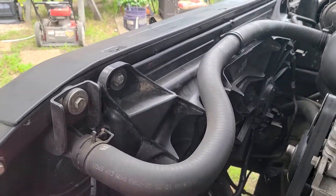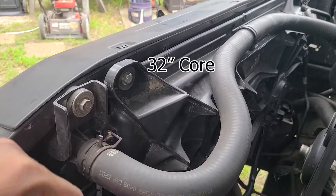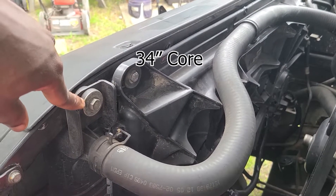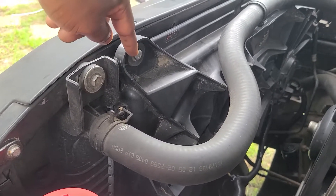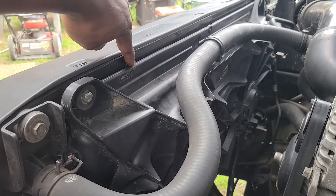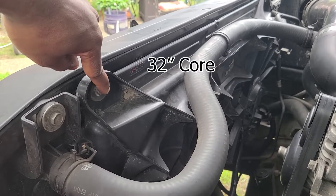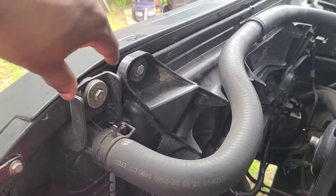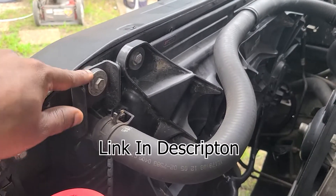Now how do you know if you got the bigger radiator? Go outside and look right now. If you got the small radiator, it's gonna be screwed right here. With my electric fans and the bigger radiator, it's screwed on the outside because the smaller one doesn't take up as much space. If you got the fan clutch shroud, it's gonna be screwed here — and there's nothing here, you got an empty screw hole. If your screw hole is out here, you already got the bigger radiator.